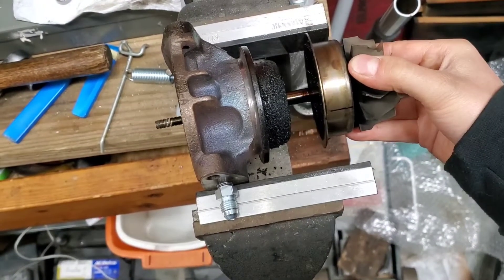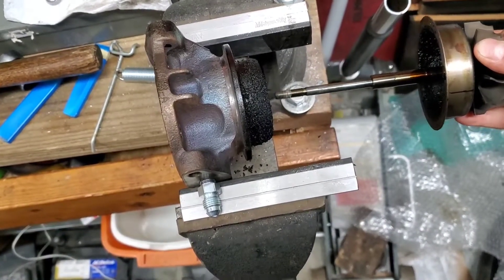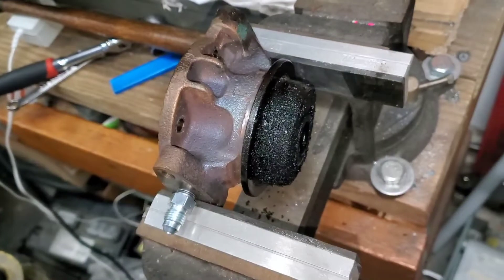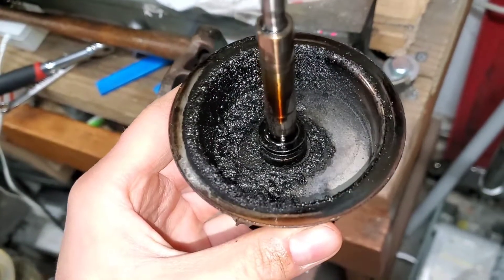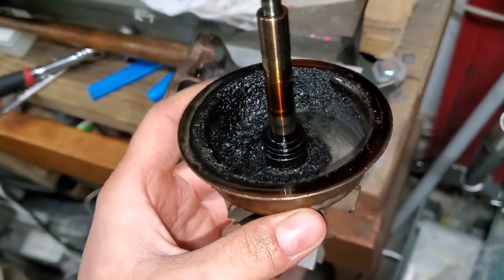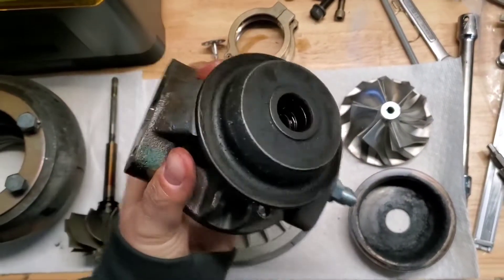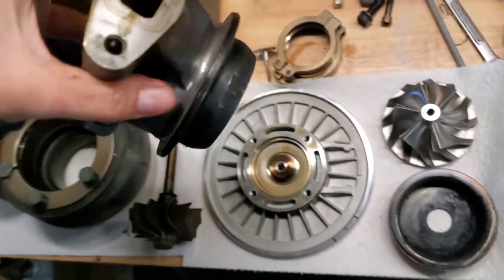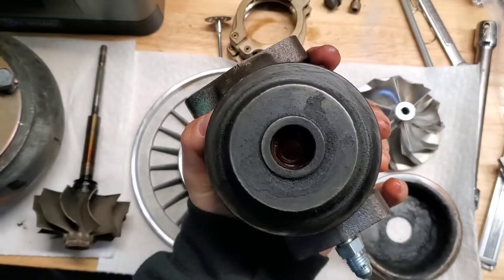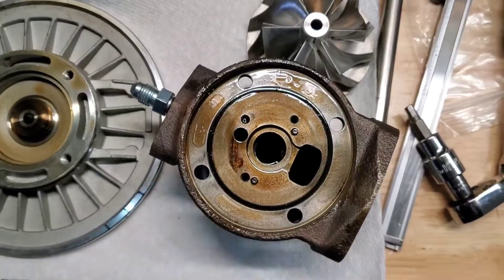It's all light copper and might be worn out pretty good — you can see a ring in here. Take the whole shaft out carefully and don't scratch any surfaces. Usually on turbos when they start smoking, you'll get a massive amount of coking on the back, and usually the culprit is the little piston ring at the bottom. I just did a little cleaning on the backside to get out the carbon deposits and bad oil. Make sure you sand it upside down so debris doesn't get inside the turbo. I'm doing this before I take out the snap rings and center bearings.